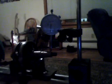This is the flywheel side that I'm using, which is the longest run, which will be by far the most accurate. The longer the shaft you have, if you have like a 10-foot shaft and you zero the end of that, it's tight here. So what I'm using is the longest end of the shaft. I'm looking for the lowest end, because the lowest end pivoting it in the middle means that this web is actually too high. So you've got to work backwards. So let's just run it again. In this case, that's 0, and that's +6. So if that's +6, that means it's higher here, which means that this must be sitting this way.